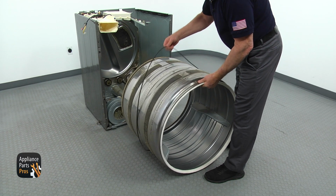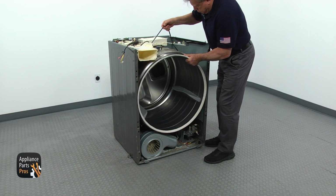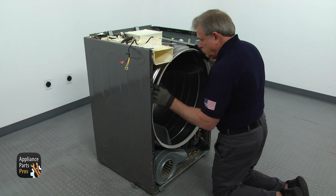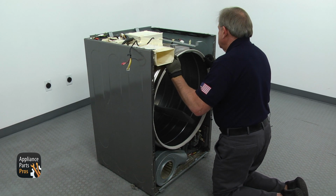Place the belt on a drum with the ribs inside. Install the drum inside. Make sure that the rear edge is on the 3 rollers. Place the gloves on and dive under the drum. Loop the belt over the idler pulley, push the idler pulley up, and install the loop over the motor pulley. Slowly turn the drum one full turn manually to check the belt position.